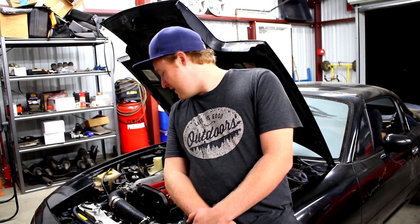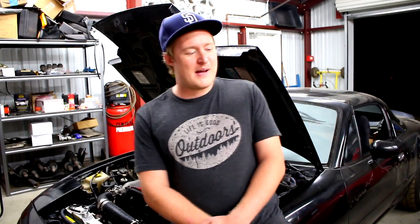I'll admit part of this is my own stupidity and negligence. I started it because I wanted to give it some running time, get it warmed up and give it a few cycles. I'd driven it a few times and it was totally fine. This time I was letting it sit and idle while Matt and I were busy in the shop doing something else. I wasn't paying attention, and I think the fans weren't coming on - I don't know why. Obviously it got too hot. Looking inside, I don't think the engine itself got too hot or was damaged, but it did blow the heater core.